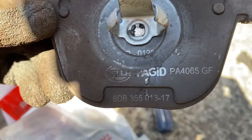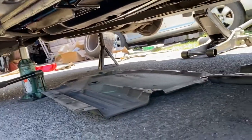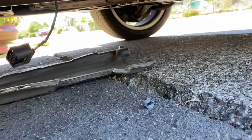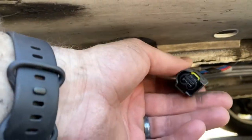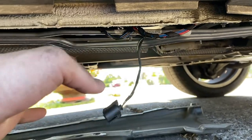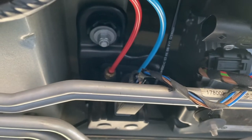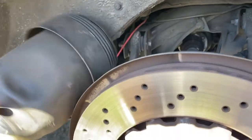To release the old airbags I removed all these panels from the passenger side — I probably could have gotten away with just removing the front one, but anyway. So this is the main connector to the air compressor for air suspension, so I disconnected it. I also released air from the driver's side — I unscrewed it, let the air out, and now I'm ready to pull out my old airbag. And here it is — I just removed it.